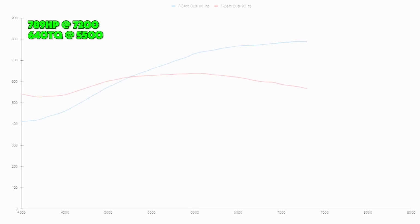One thing that you guys are going to notice is that these numbers are for the hydraulic roller engine. And keep in mind that just because some of these manifolds that you thought would make more power didn't make it, or maybe some that you thought would make less made more, that the engine demand is a lot less than what a lot of these intake manifolds offer. The motor doesn't need that much to be efficient. Keep that in mind, and you're going to start seeing a much bigger spread when we get to the solid roller motor where there's more demand for intake charge. So that is the hydraulic engine combo.